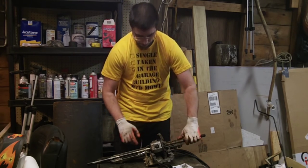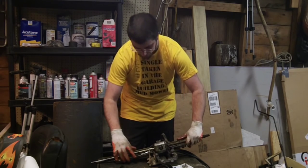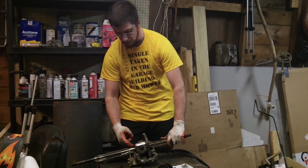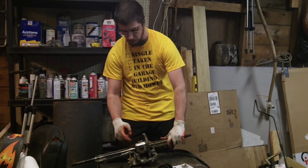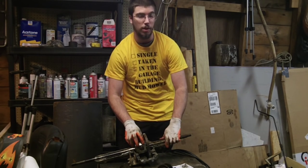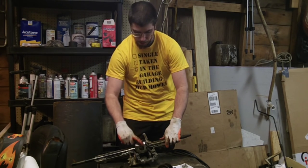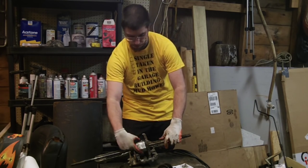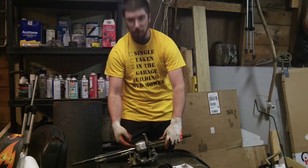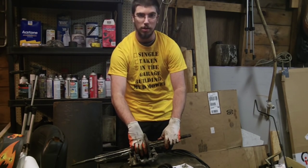What I've discovered is that if you set it in and pull it all the way to the side, then pull the other axle all the way to the other direction, you can set this bottom piece that's on the inside of the differential cover. I'm going to refer to this as the differential cover, because that's basically what it is. Your spider gears are actually inside, going through this bolt here, and you've got a gear on this side for this axle and a gear on this side for this axle. So this is essentially an internal differential inside the unit.